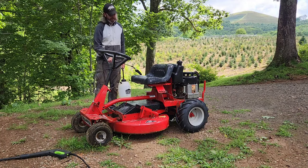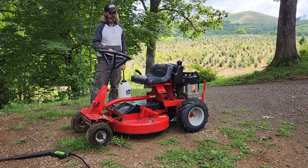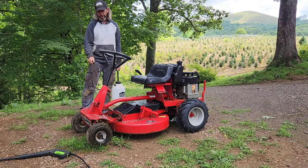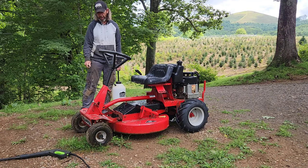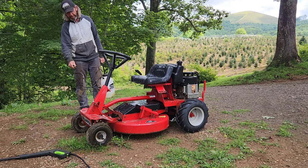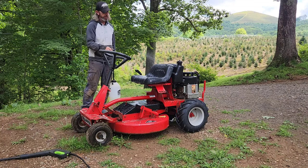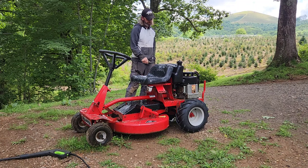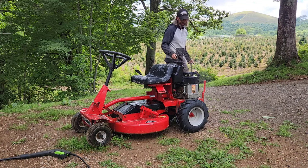And to do that, you can spray WD-40 on it and sand it, and that's going to remove the majority of the surface rust, if you didn't know. And then after that, like I said, I'm probably going to use some high temp engine paint and paint that. I've seen some different people doing it on YouTube, and they had pretty good success with car exhausts and stuff like that. The main purpose is just to keep it from rusting. I don't expect it to stay pretty over time.